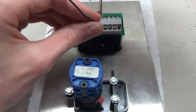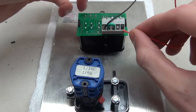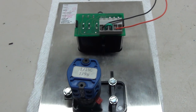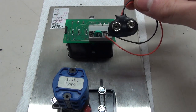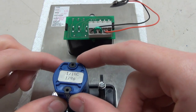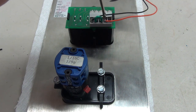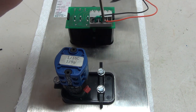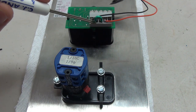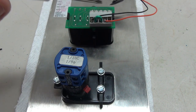If you only have one button and that's all you want to do, just hook up a 9-volt battery and you're good to go. Now if you want to hook up the fire service switch, you'll need to add additional wiring. Bring a wire off pin four to one end of the switch, and then the other end goes to either pin two or pin three - it doesn't matter which one - so it can light up the LED.